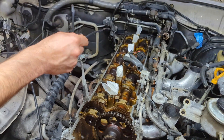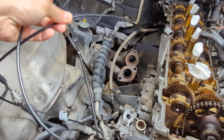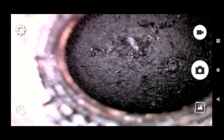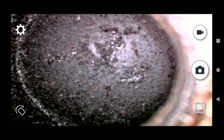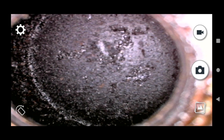So I'm going to pull the paper towels out of number two and number four, go down in and check the combustion chamber on top of the pistons, see what we can find there. And then we're going to check out the exhaust ports on this side. We have a lot of carbon buildup in there. I'm willing to guess that nobody has ever run any sort of engine cleaner or fuel injector cleaner through this thing. That probably explains also why those valves are sticking — there's a lot of carbon buildup there.